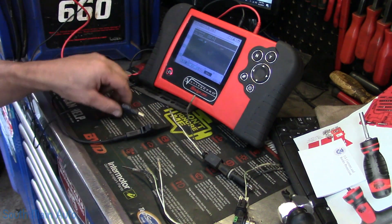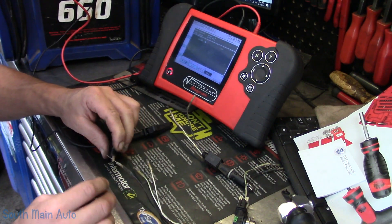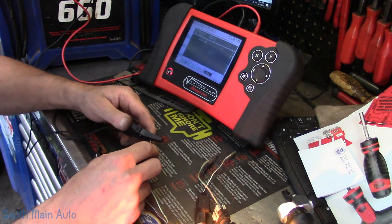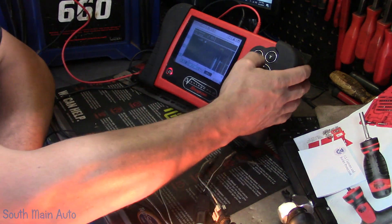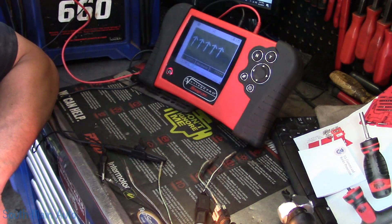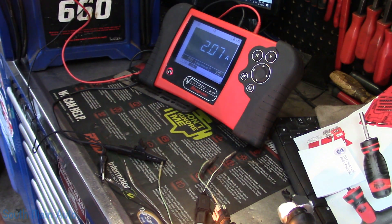So I've got our amp meter out here. I've got our leads hooked to my jump pack over here, running through the meter. We're just going to do internal amperage. I'm going to hook the ground to the ground side. Now you can see I've completed soldering on all these ends. We just want to know what these bulbs put out, so I'll hook it to one at a time. Let me switch this to digital mode — we'll go amps internal. Out of limit — we'll go up to a 5-amp mode. We can see we're drawing 2.07 amps.